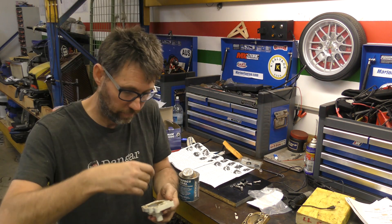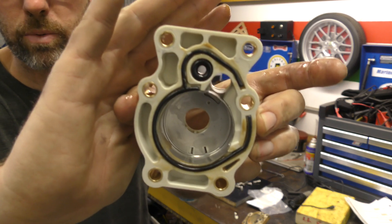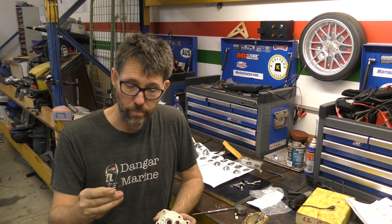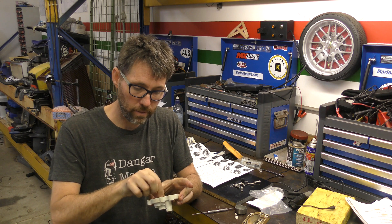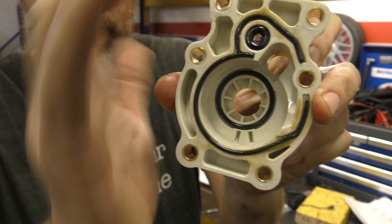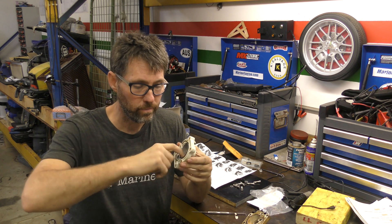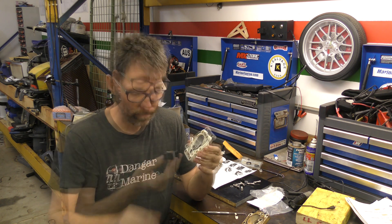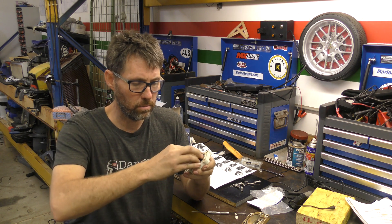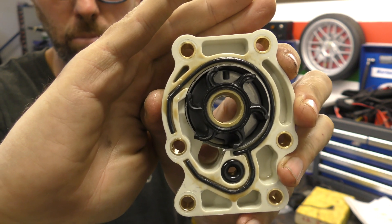I missed a step — after you've put that thick o-ring in that goes around the shift rod, there's a larger o-ring that goes inside the top of the pump housing above the metal cup that holds the impeller, and that goes in the centre here. Next it says to lightly coat the inside of the cup with a bit of oil. They say oil in this case rather than grease. After that, install the impeller by rotating it counterclockwise — get it in with a bit of twisting motion as you're pushing. It's that twisting motion that gets all the impeller blades pointing in the right direction.